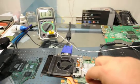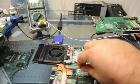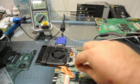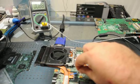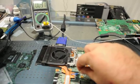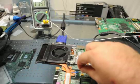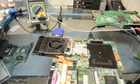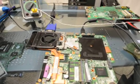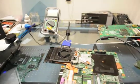So we'll go back to the chipset. We're on the chipset right here, and it's going up, up, up and away. Then we put it here on the actual heatsink, and it shows that at idle rest it's between 2 and 12 degrees. It then pulls off of the chipset and pushes to the heat pipe. This has done 5. So 5 degrees at idle rest means that this thermal compound is within the manufacturer's specifications, and it's pulling enough temperature off to justify saying that we've actually heat cured this system and that it's done.